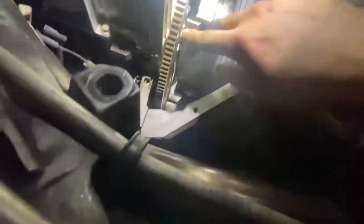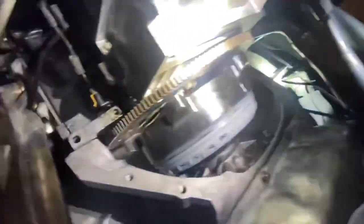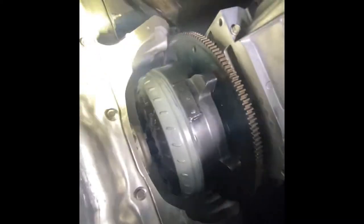Next step I'm getting all the bolts in up top. Looking all the way through — can't really see on camera but they're all about the same distance, close to an eighth of an inch. It's getting nice and dark out, but we have the cross member in, the bolts holding the transmission are in, and now we have to work on the torque converter, bolt it to the flywheel, then the driveshaft and some other stuff — and then it's me driving around.